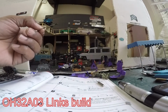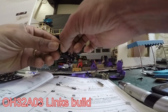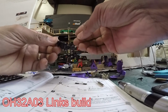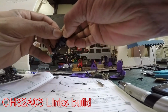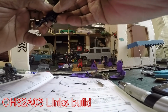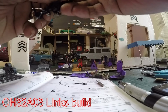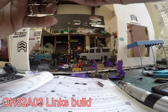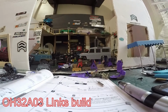And I'm just gonna guess, because I always know that you always do the steering linkages first, so I believe. I'm just guessing. Whatever link is single, it's not gonna have us doing a panhard bar. That would be sweet, though. They should put that in the kit. Panhard bar really helps. Even with 4 links, I'm telling you, still need one when you put the bigger tires on.